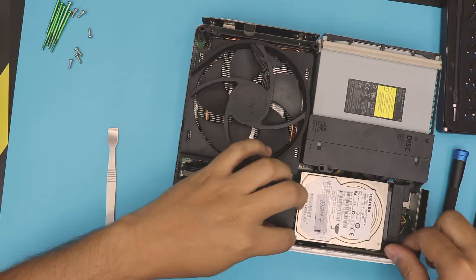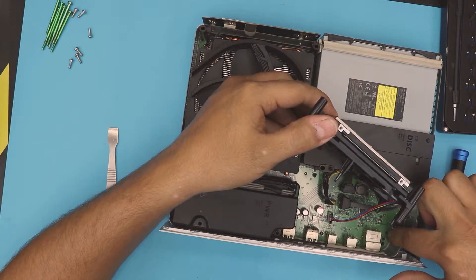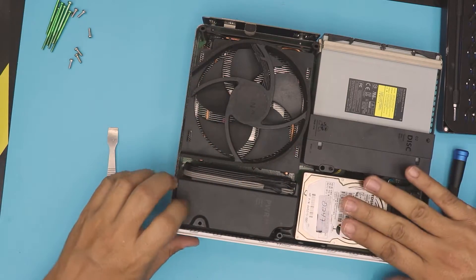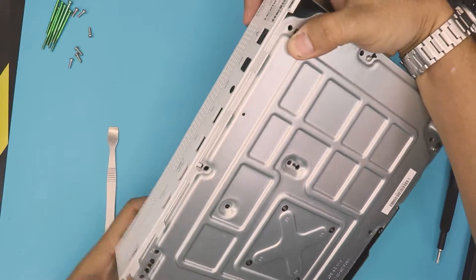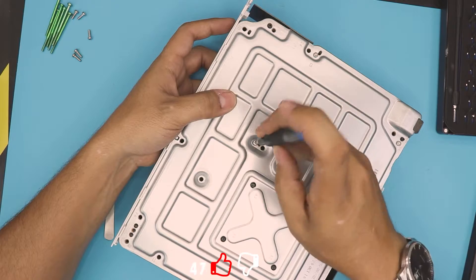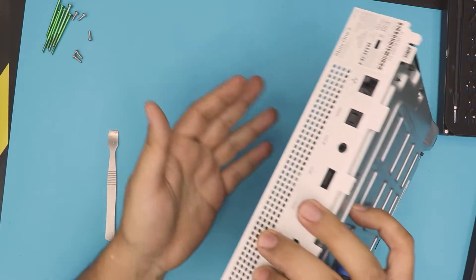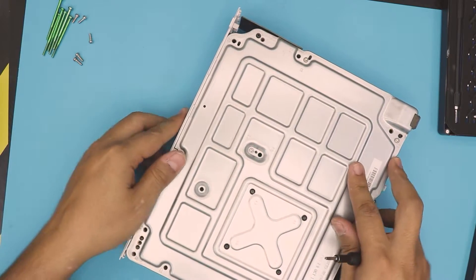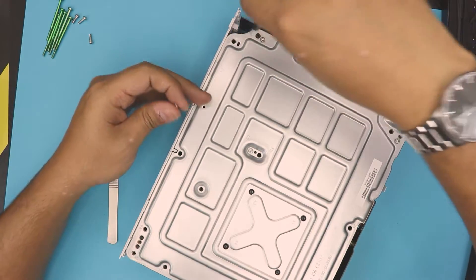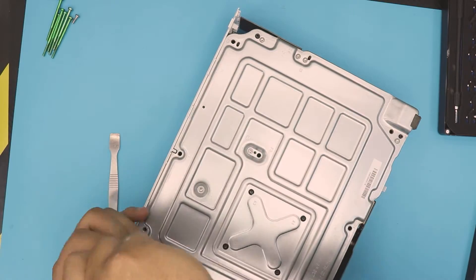Next, put the hard drive back on top. The hard drive has little plastic pins on the case — these tiny plastic things have to go through the holes, so juggle it around to get it to sit nicely in place. Once it's seated, hold it with your hand and switch hands while holding it, then put at least one screw in. Use your other hand underneath to hold the hard drive while putting one screw in — now it stays. Put all the screws back: the other two for the hard drive and three screws for the power unit.